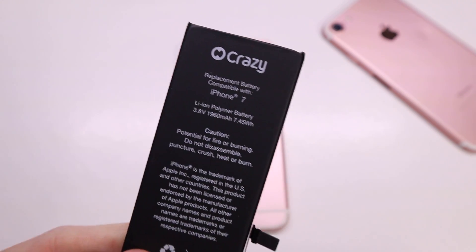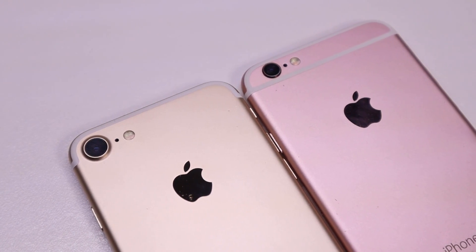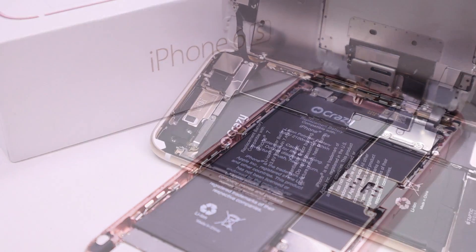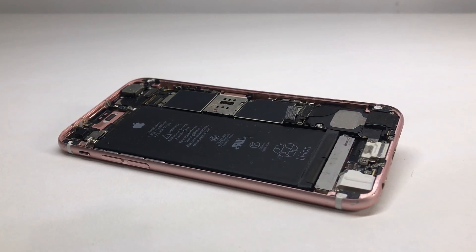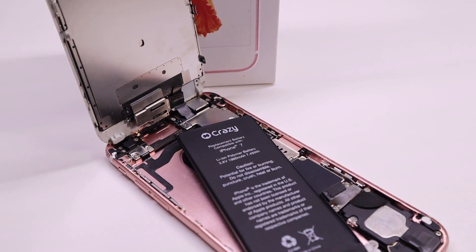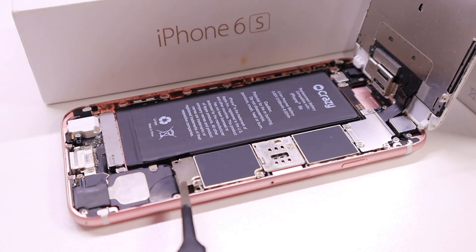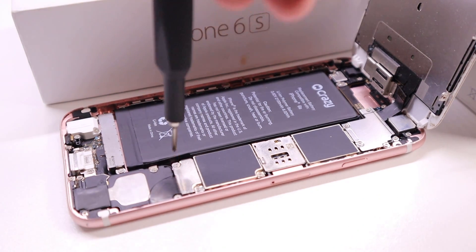So, can you use an iPhone 7 battery in an iPhone 6s to receive better battery life? Not really. Theoretically it works but it's not reliable, and I would not recommend doing it. Maybe there's a rare case where you could use it as a test battery, but personally I'd steer clear as it could damage certain chips on your phone given the different circuitry in each generation of iPhone battery. Given the circuitry inside the battery that communicates with the phone, it is very unlikely a newer battery from a newer iPhone would work in an older generation phone, even if you did modify the battery connector.